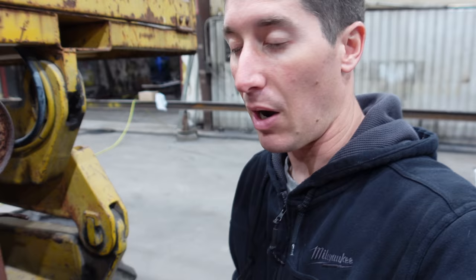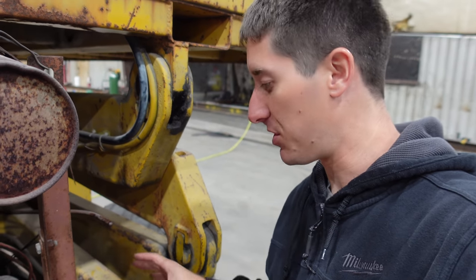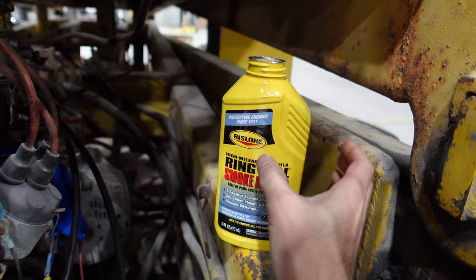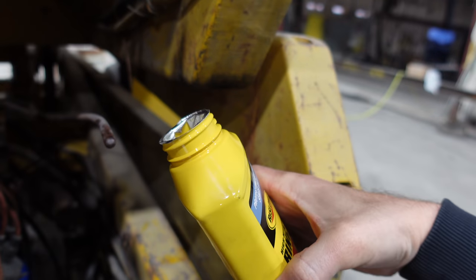You can see from the colors down there I got most of that stuff flushed out - that's fresh oil running out of there. I went ahead and put in just a little bit of the Syntec just to start with. And as that watery, milky oil runs out, we'll put the plug back in and then we'll fill it with the Rislone and then fill it with the oil. I stuck my finger in this accidentally and it is pure slime - look at it move. It's like honey from the local honey stand right there.